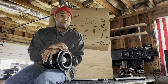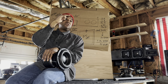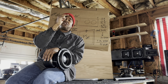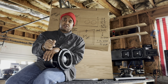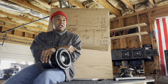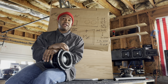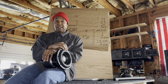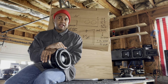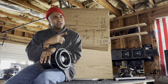You can't figure that out. Let me bring it to you and break it down for real. Improper box. Sub inside that improper box — sub prone to failure. We sell you the box, we sell you the subs, sub prone to failure, we sell you the recone. We know you're going to come back because you're going to try to play music that the box is not going to enable the sub to do. It ain't the sub's fault. They can't take the power, and they keep trying to tell you to add more power, find a better amp. There's no pressure, there's no spring back there — they can't cool effectively. So the people that sell you the box are also going to sell you the sub, and they're going to sell you the recone.